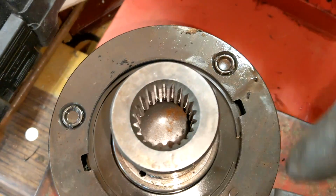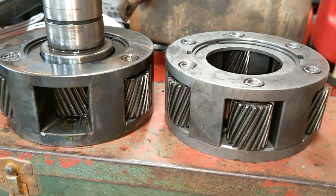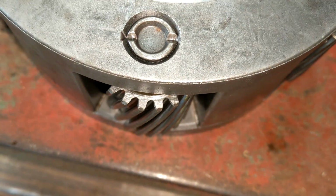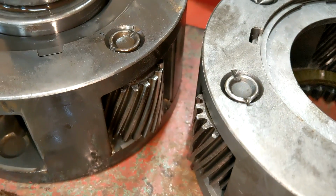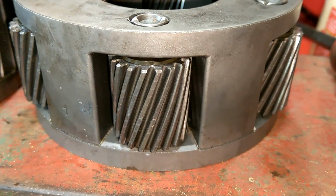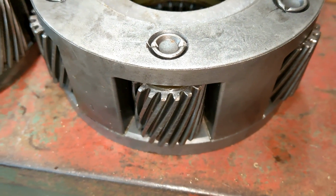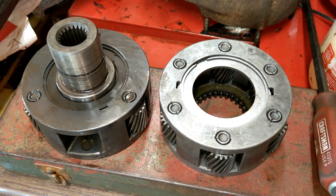Looks like it's this big outer clip here. Okay, so that's what we're suffering for right there. Mo pinion, mo better. So you can kind of see the, I guess, rounded cut of the old style gears. So I'm assuming that the new ones are much sharper. So yeah, if you're looking for these in the junkyard, I think that these are in 241s. Don't quote me. Look it up, do your own research, but you gotta make sure you got the right year, because the teeth are different. Cool. So yeah, I guess we take out the clip and swap things.